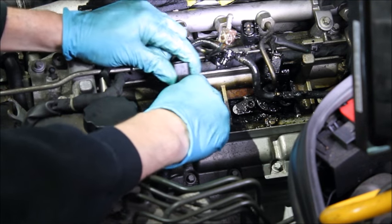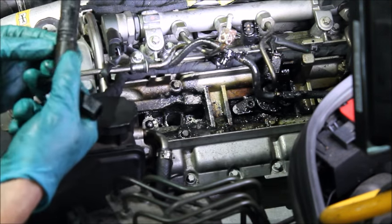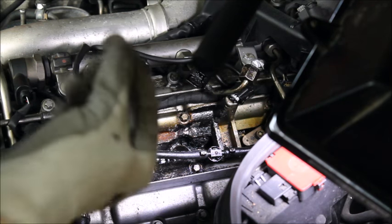Now it's time to remove the injector. If you're lucky, with a bit of perseverance and wiggling the injector back and forth left and right, you'll be able to free it and simply remove it. However, as you move on to the other injectors — doing all six in total — you'll likely find some that stick and require other measures. Once you've got the injector out, I recommend dropping something down the hole to stop any debris or carbon falling down into the cylinder. I use a washer that's just the right size with some double-sided tape on it. Drop it down into the hole, seat it at the bottom, and as you continue cleaning the area it prevents debris falling into the cylinder. You can then vacuum it all clean before removing the washer again.